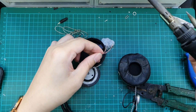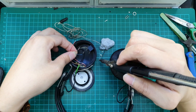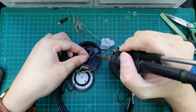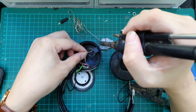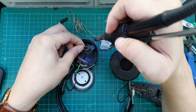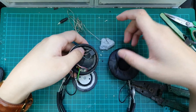The last step will be to solder the wire down to the connector. The solder is not clean so I need a fresh bit of solder — let's try again. Next will be the right side, and finally the ground. Be careful not to burn anything with your iron; for example if you burn the housing here, the smell that comes out is very unpleasant and it's toxic.